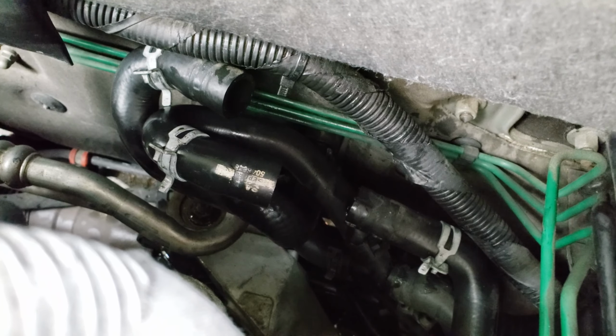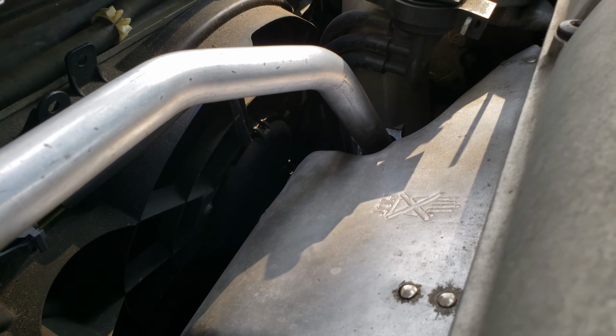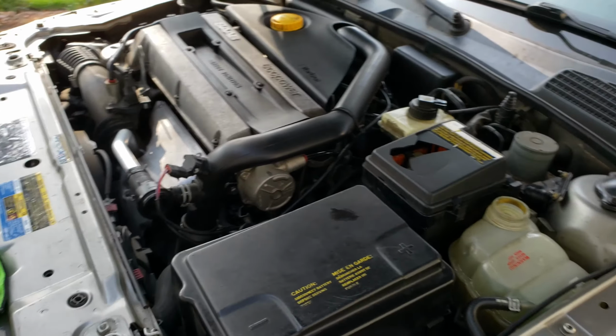It's not leaking. Still getting a lot of oil through the intake. I think the turbo seals are about done. So the one thing, it's not leaking, coolant's not leaking either, you can't really see it, but I'm trying to see one of the clamps, that white clamp down there. The one thing that's left is I think one of the radiator fans is cooked because I keep smelling burning cotton. And when I started this up just now, you can hear the AC is on. So when I started it up, I can still smell it. But I can't see anything. That's aggravating.